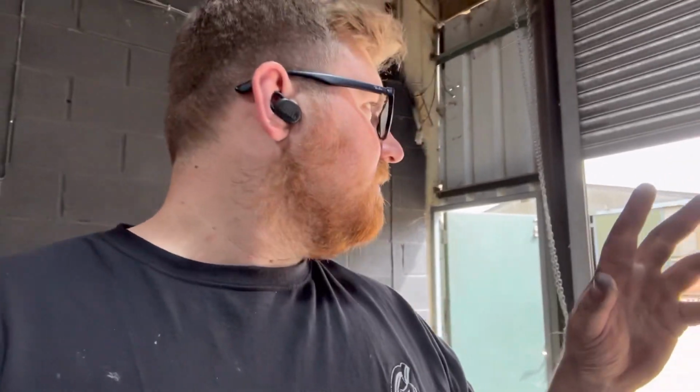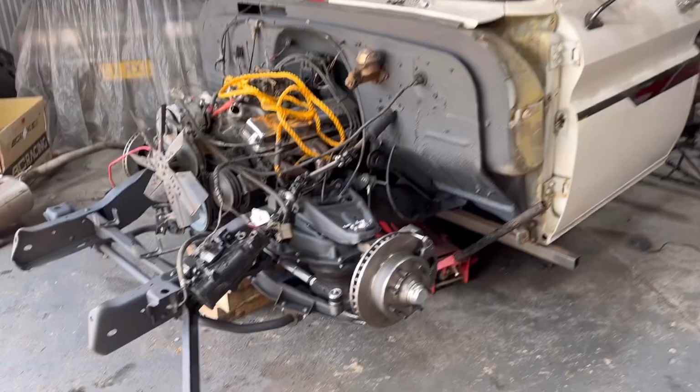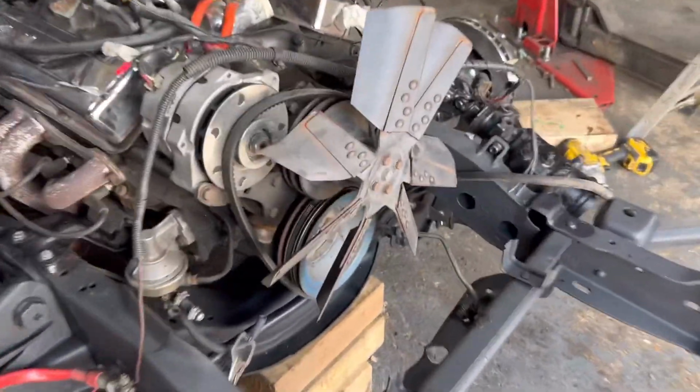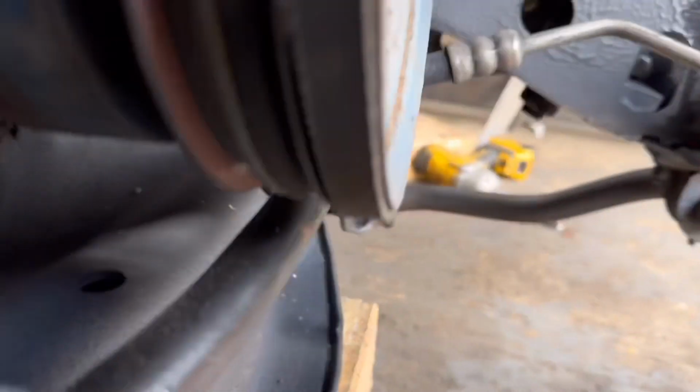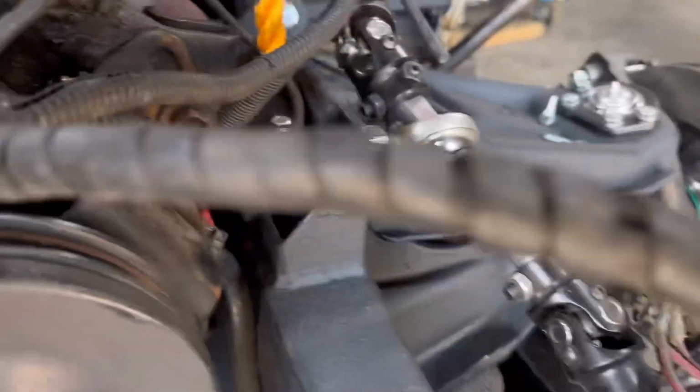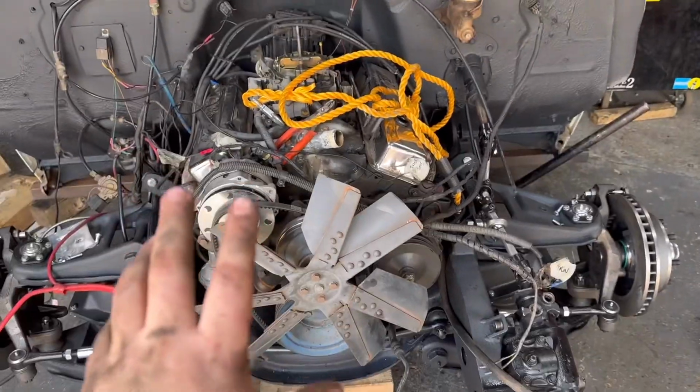I've actually got the engine in a position and the gearbox in a position where they're gonna sit once all is said and done. So as you saw, I think in the last clip, the steering arm was actually touching the bottom pulley. And as you can see now, we're just clear. You might be able to see there's some spaces under the engine mount all the way around. So that's raised the engine up 30 mil and the next course of action would be to raise the gearbox